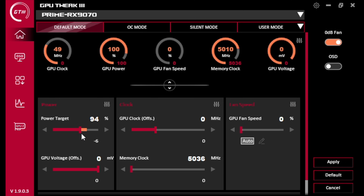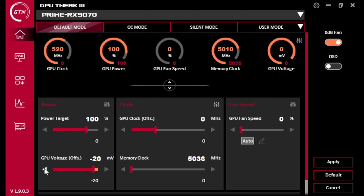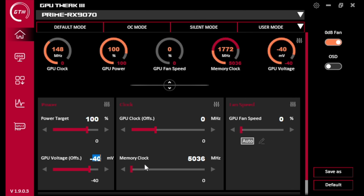First off, before you start playing with power limits, I would want to see how much we can offset the voltage without crashing the benchmark. Do take note of your benchmark scores — this gives you valuable information of how your performance is scaling. It's also important to note that offsetting the voltage in GPU Tweak 3 doesn't lower your power. It's actually lowering the required voltage when referencing a particular frequency, so the whole curve is basically undervolted. At equal power, you will be running a higher frequency — it's overclocking at stock power levels because we haven't touched the power slider. So for this phase, you should start seeing better scores. Go ahead and keep that power limit at 100%.